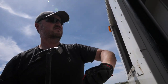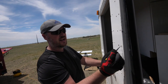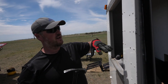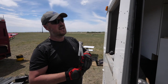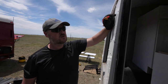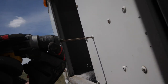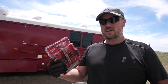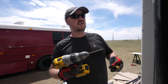With rivets, there are two different kinds on this bus. There's one that has a center post, put on from the outside, and then there are rivets put on from the inside — those you just have to drill straight out, or use an angle grinder. But the ones with the center post are nice because you can pound those out with a nail set and give it a whack. It makes drilling a lot easier since it gives your drill bit a place to seat, and it really just reams it out fast. Right now I'm using the Hard Metal Milwaukee Cobalt Drill Bit Set — they really cut through these rivets. I'm still on my first bit and I've already drilled out probably a dozen rivets.